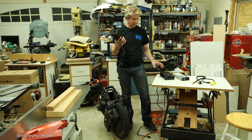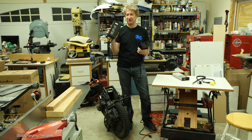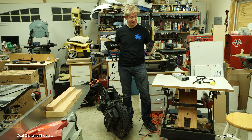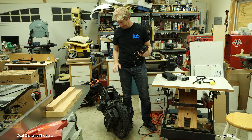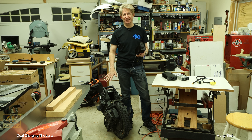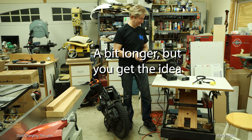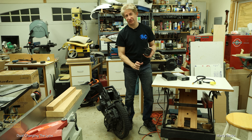So today what I'm going to do is use the Roger Smart Charger at 10 amps and the stock charger at 5 amps to charge the Lynx at 15 amps total. That's a lot of power at 151.2 volts. I think I've got about 40% battery, so I'll fully charge this wheel in about 30 minutes. But if you're empty, with 15 amps and two chargers, you can charge this guy up in under an hour. Pretty amazing. Let me pull the camera in and show you the process, which of course is very simple.